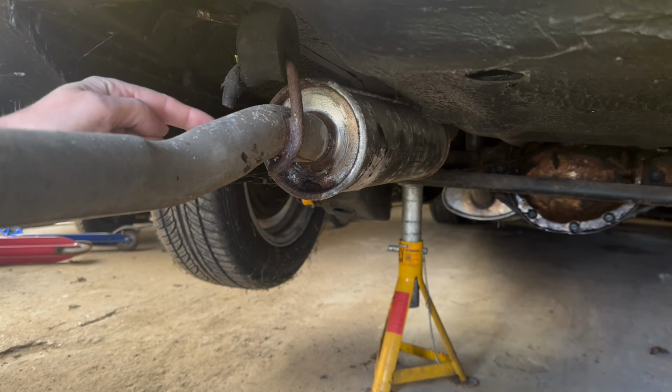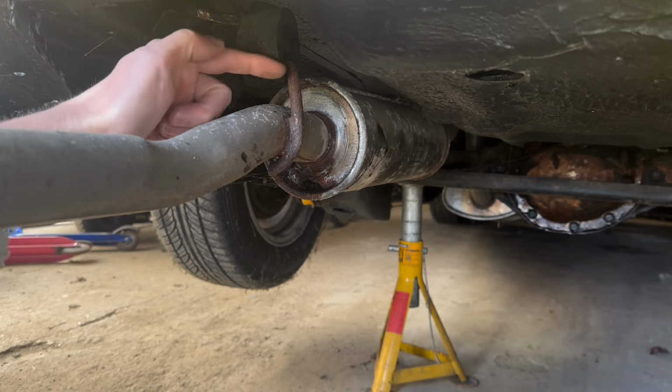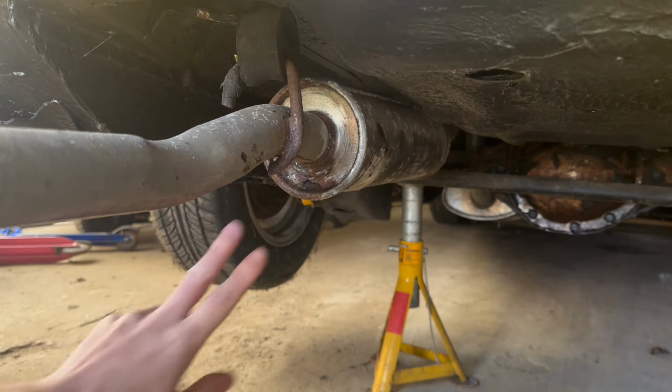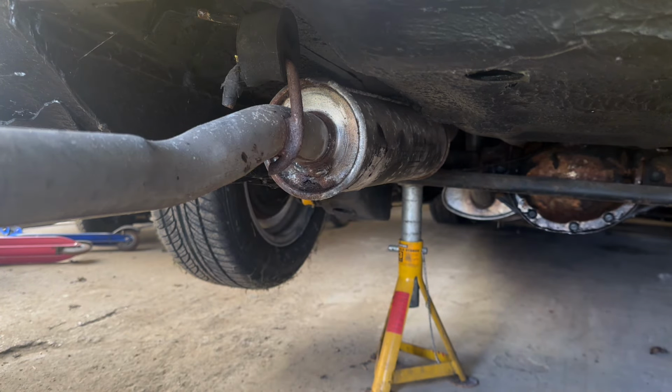You can see in the picture that it's actually welded this side and it comes up that way. I mean, that wouldn't be an issue. But obviously, if it's out of that angle, we'll just chop it off and weld it to where we need it to be. We'll have to modify the tube that comes off the center box to the right angle, and then possibly we'll keep that as a sliding pipe and then just weld a flange onto the end of that.